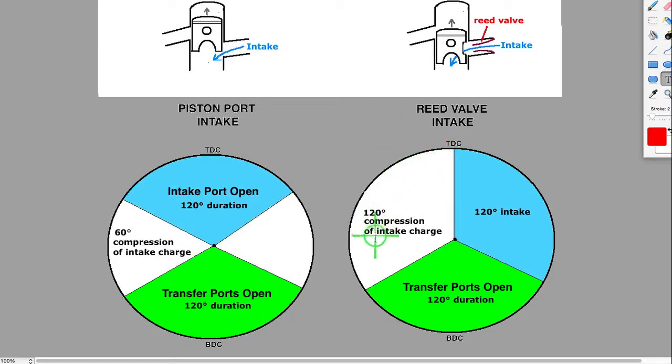Even though you've got 120 degrees of compression, a lot of the reed valves sold for motorized bicycle engines wind up having a lot of space above and below the reeds, and a little bit to the side of them. That reduces the compression ratio of the crankcase. So you can't say the reed valve gives you exactly twice the compression of the piston port — it is more, but not as much as you'd think. This setup helps compensate for that by completely sealing off the intake area. When the piston closes that off, it's sealed and it's just the space in the crankcase, which helps to compensate.